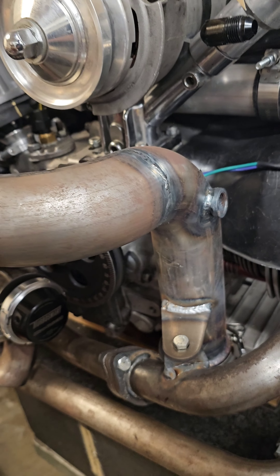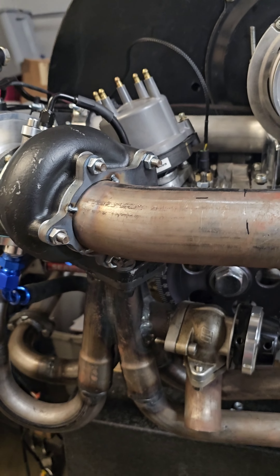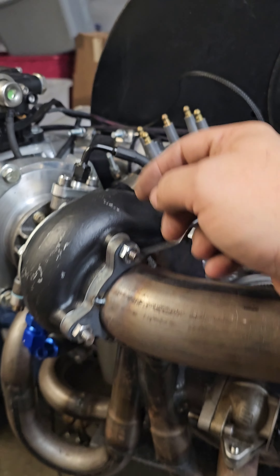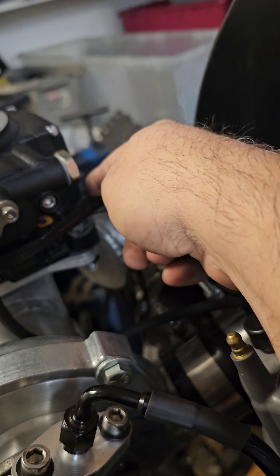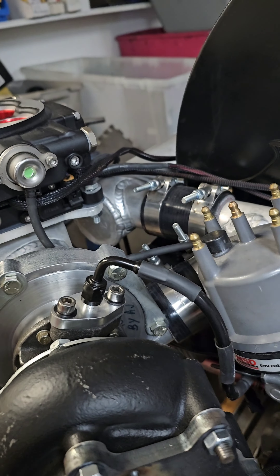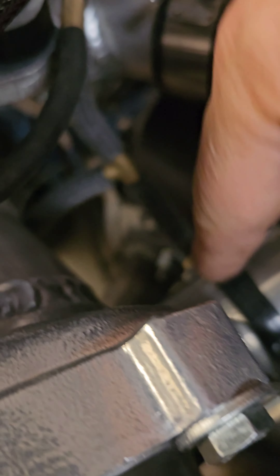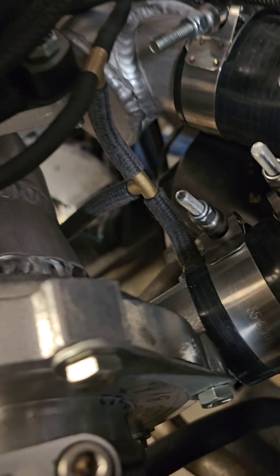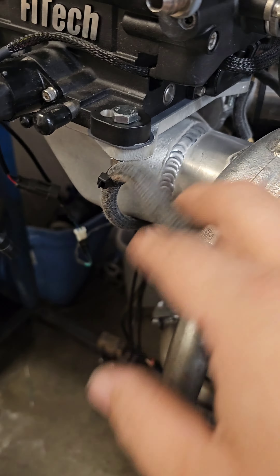Okay, got that on there — it came out good. Next I'm going to start working on the valve covers and I bolted this up officially. I gotta run the boost line over to the turbo outlet and also plumb the regulator into it and the port on the front for the actual map sensor. So now I've got the boost lines all hooked up — you can see it comes out the side of the turbo, goes to that first T, and the part that goes under there comes around up and over and goes to the wastegate.